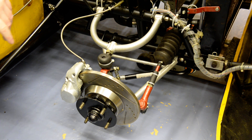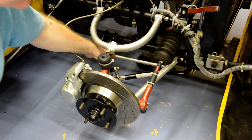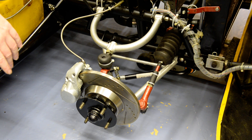That's been mounted to the car with Superflex bushes, which are polyurethane. Crucially, in order to fit this anti-roll bar, I had to do away with the standard drop links that were supplied by TVR, which were in fact Spitfire ones that had been cut and shut. As you'll notice, I'm using rose-jointed anti-roll bar drop links, which allow for much more adjustment and are much more workmanlike. They don't have the same squidginess or flex in the bushing, since there aren't any bushes — they're rose joints.